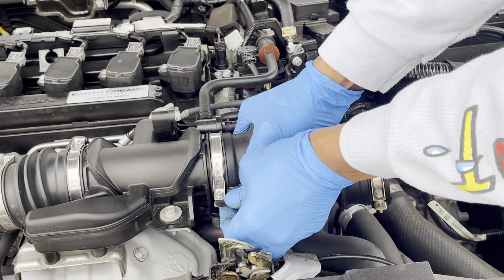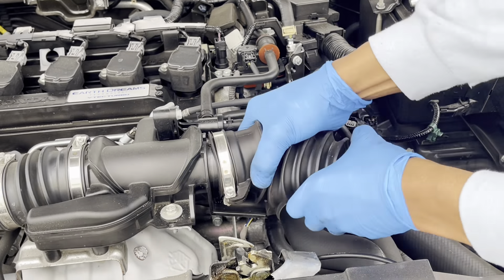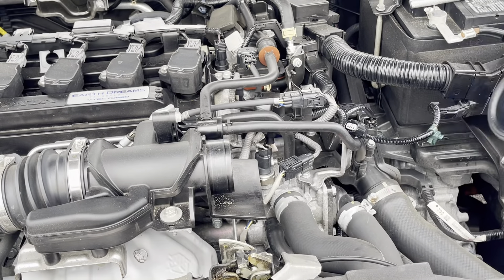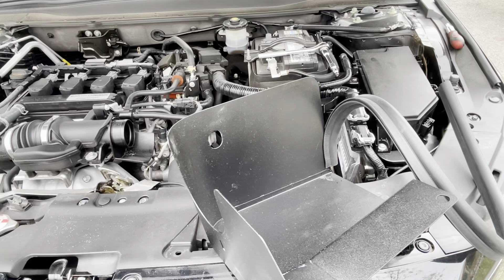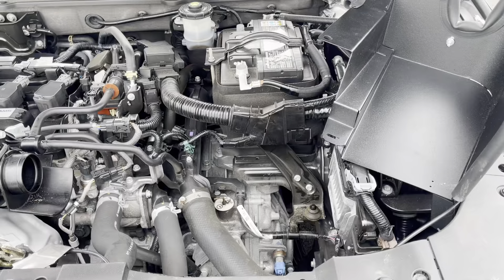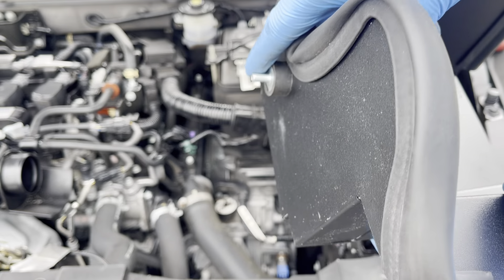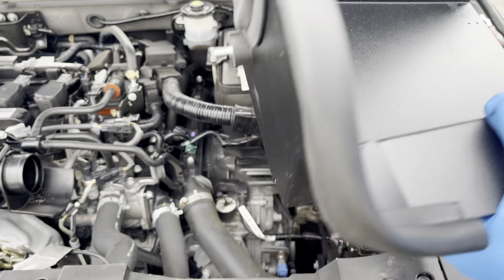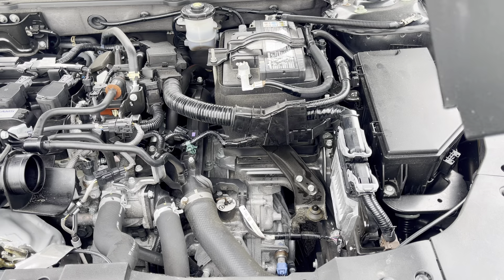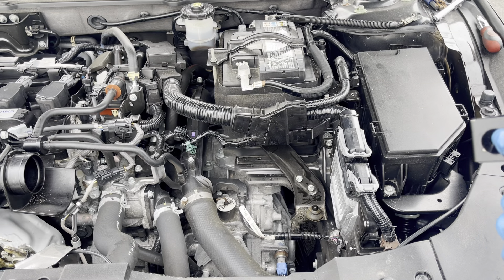Next, we are going to install this piece onto the heat shield. What I didn't show is I installed this piece right here — it's just secured by a washer. You just put it on the other side and tighten it down with the washer and the nut. Now we're going to put this in the engine bay. You're going to slot this piece right here into this. If this came off with your stock air box, then you would take that off the stock air box and put it on here. In my case, it came off right here. So let's get into installing it.